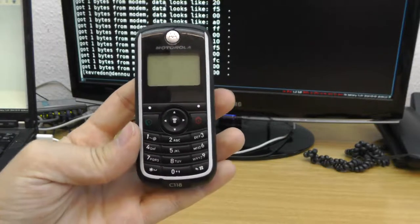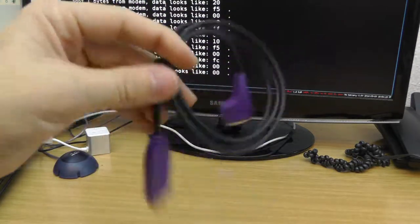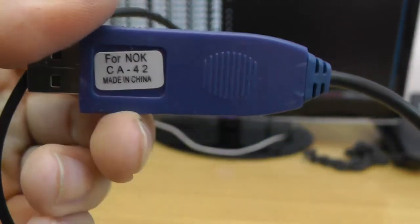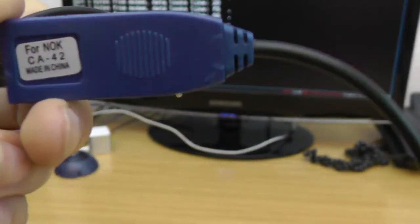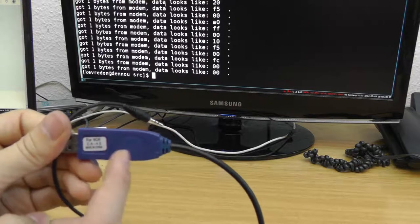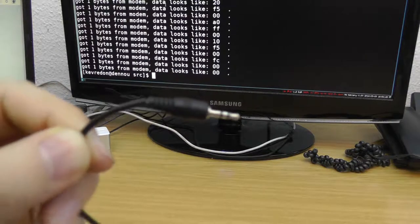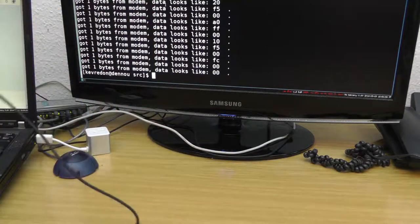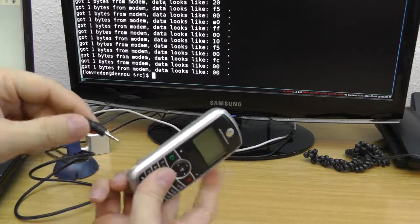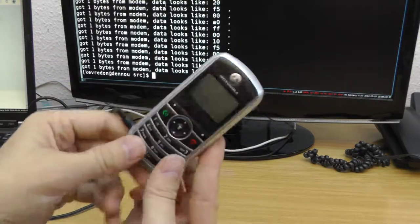Once you have one of these phones, you also need a serial cable to be able to flash the firmware on the phone. The cheapest one is a CA42 — it used to be a Nokia adapter cable. This includes a USB to UART converter inside. On the other side, you cut the connector and replace it with a 2.5mm stereo jack, so you can plug the USB to serial into the computer and the 2.5mm jack into the earphone port of the phone. How to wire the connection, you can find on the Osmocom Wiki.